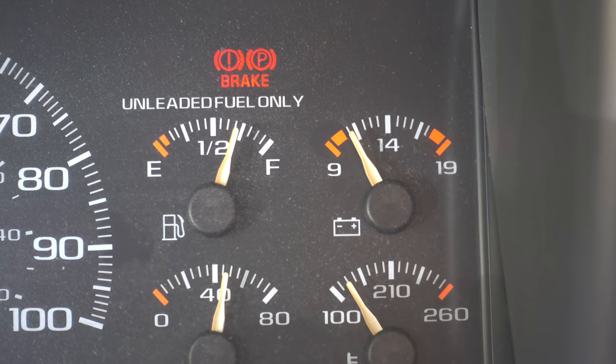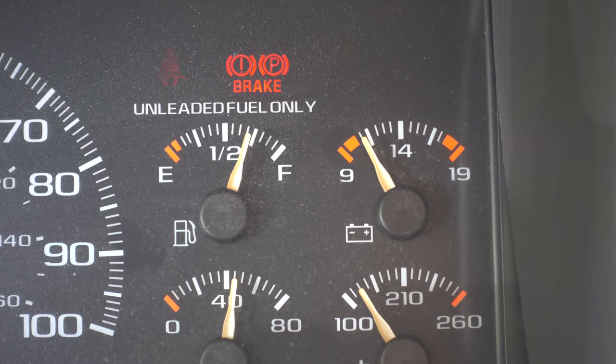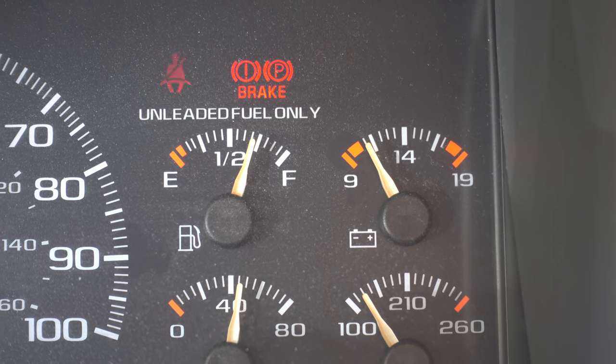But now I'm having another problem, and I think the problem has to do with my battery. One of the things I noticed when I first installed these fans is that my voltmeter would go from about 14 volts slowly down to about 12, and sometimes even into the red zone. Now it goes really quickly from 14 volts down into the red zone and just hovers there. I'm guessing that's where the alternator is trying to keep up with the current that the fans are pulling.